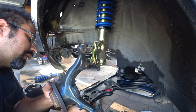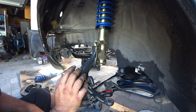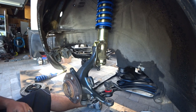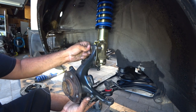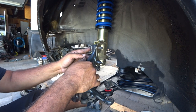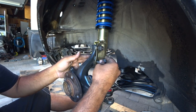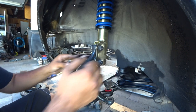What I like to do first is mount the ball joint first, sliding that in, and then slide your spindle. We're using Corrado G60 spindles on this car so we can use much larger brakes — we're going to 11 inch brakes versus the 9 inch brakes that came on this car. Now one thing you're going to notice on Mark IIs, there's actually a decent amount of play in here. That's because there's a little bit of a camber adjustment on this, so when you get it all lined up and ready to go, you need to go to an alignment shop and get that taken care of.